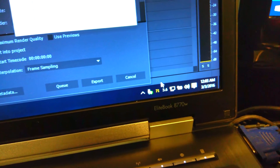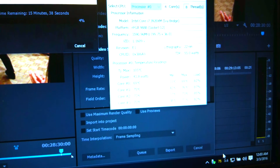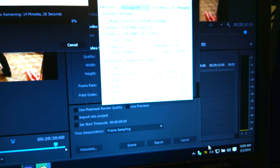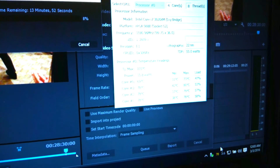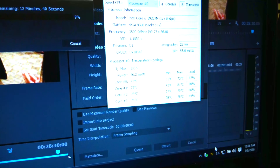The CPU usage is up but the temp isn't going up — we're not hitting that 100-degree mark. Looks like we're just in the low 70s, which is a great improvement. I would say after all this it was definitely worth it. I'd like to know how much the copper shims specifically affected performance, but clearly just getting in there and doing this has improved things greatly. I hope you're able to try this on your own system and benefit from it. I'm going to turn on my fan too, because you don't really want your CPU relying on that little fan built into the laptop.